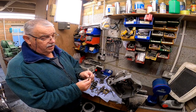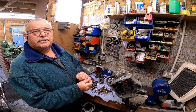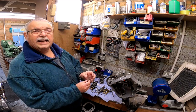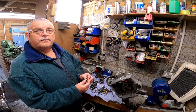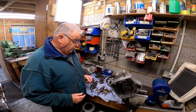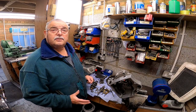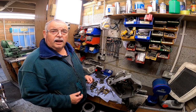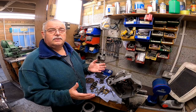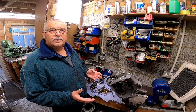And what you should find on a magnet is really a little fuzz of dark microparticles. If you end up seeing large lumps which reflect the light, chances are you're in trouble. So in fact, I have only ever had one gearbox disaster, and all I can say is I was very glad to have it contained within the gearbox and not sharing engine oil. I'll put some photographs up now, and you can just have a quick look. You can just move ahead if you're not interested, but we don't often see catastrophic gearbox failures.